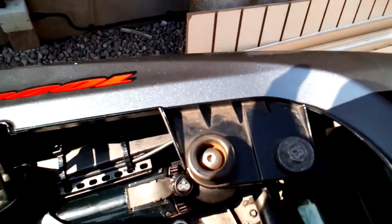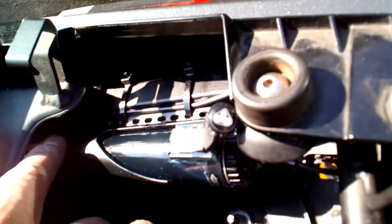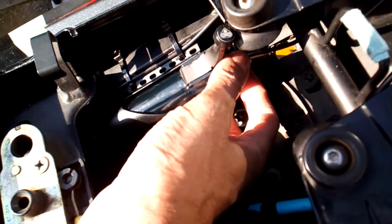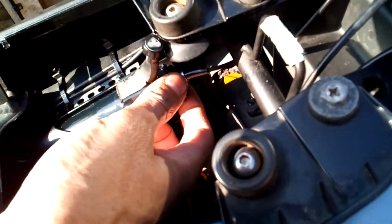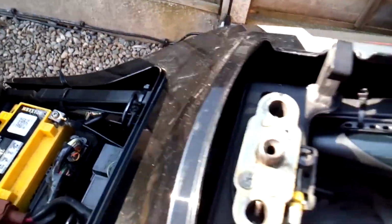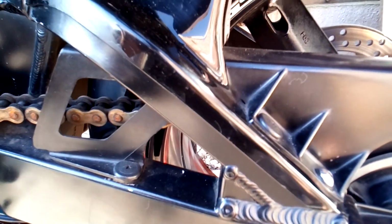Now, as I was squeezing it, it was filling the bottle, but I didn't see it filling the pipe. So I turned the bike on and just had it idling to create the vacuum, and I turned the flow regulator here on pretty much to full, and then kept squeezing, and then basically I started to see the pipe fill. We've traced it and followed it and watched it, and it all came down. I don't know if you can see it now, but it's got like a blue sort of tinge to it. That's the blue oil that's in it, and we did that until the oil came to here.